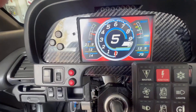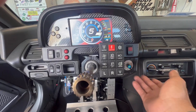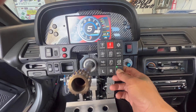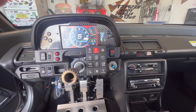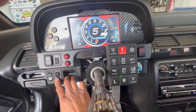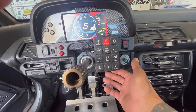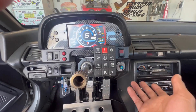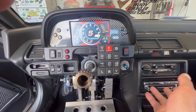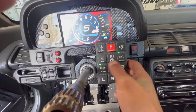If the intake air temperature sensor defaults to 77°F and doesn't know what to do, you can override and kick the fan and water pump on manually. Overriding cockpit lighting covers the interior lighting. You also have right and left blinker controls — a quick tap for a single blink, or a latching mode where you push it and it keeps blinking until you push it again, since there's no ignition reset.